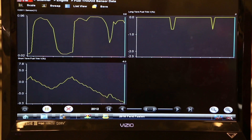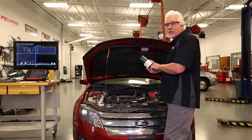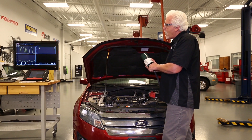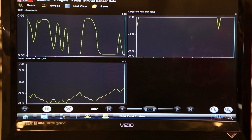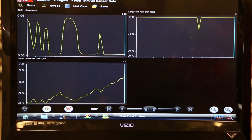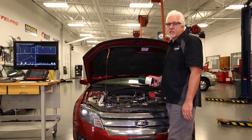The whole time I keep the propane on, we see the trim going negative until the system can account for all of the extra hydrocarbons coming into the motor. When I close the propane, I create a lean environment. We notice the O2 sensor voltage goes low and stays low, while the short-term trim climbs back towards zero. This system and vehicle are operating properly and responding the way they should for this type of sensor.